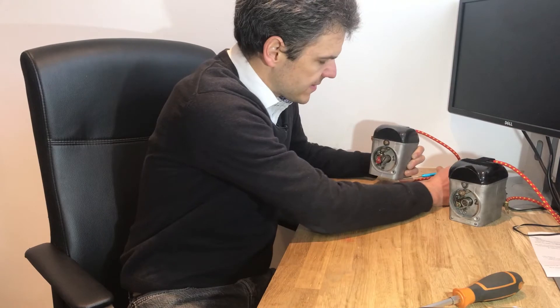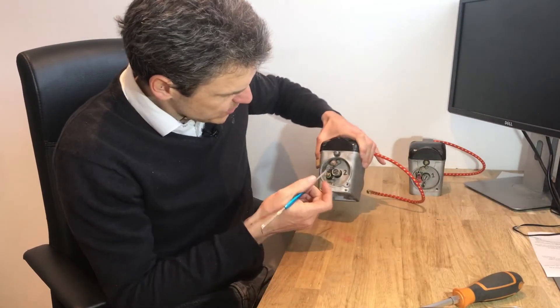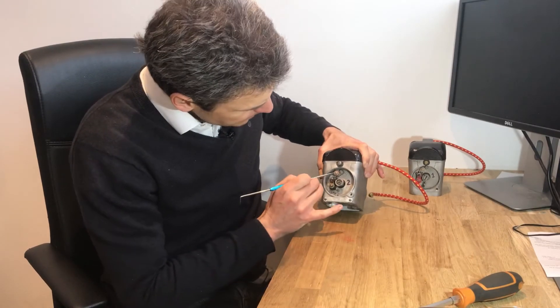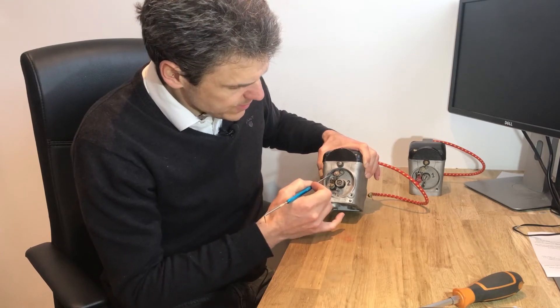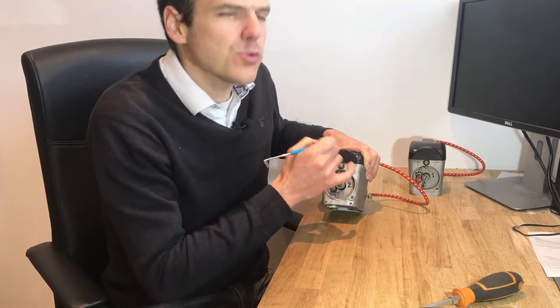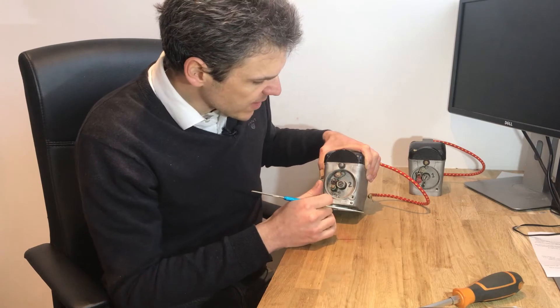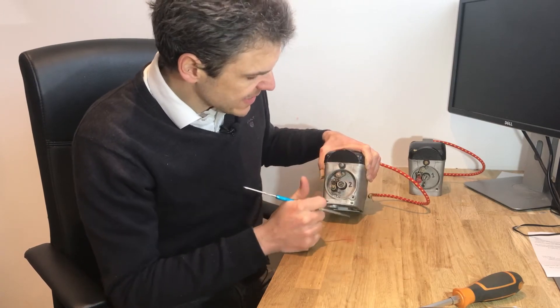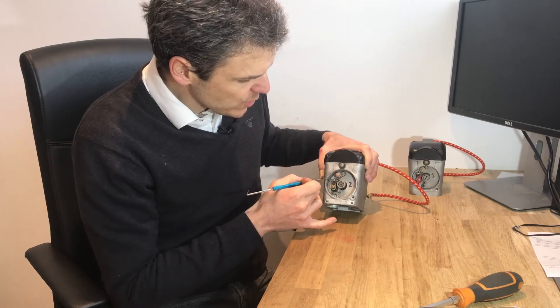That's the main reflection on this. This one has the parts in the right order. Sometimes when the magneto comes to you, you might not be able to see it clearly — so trying to copy what's there might not be the right approach, because you could be copying something that is incorrect and has a short somewhere. You should always refer to an exploded view diagram.